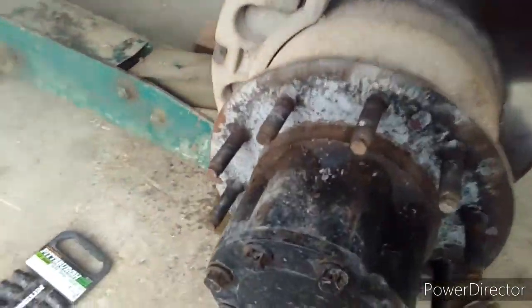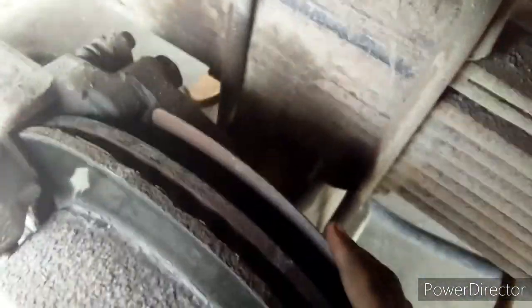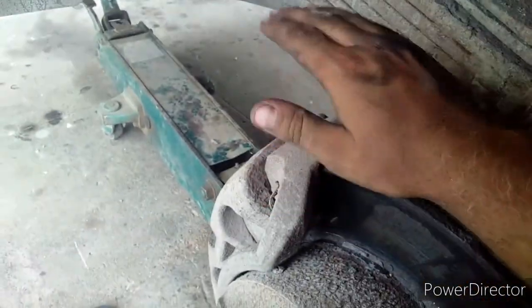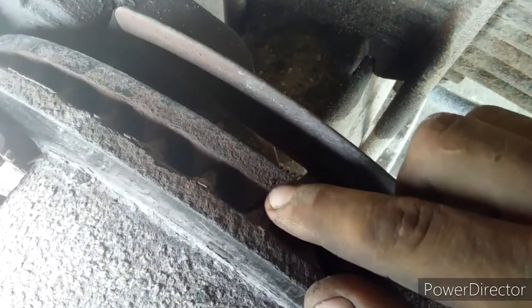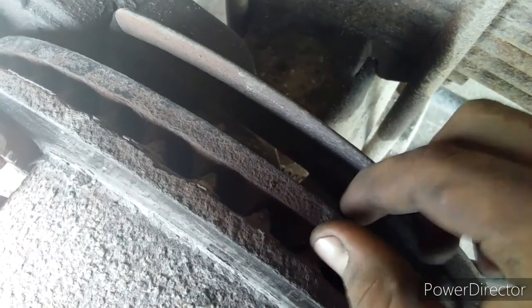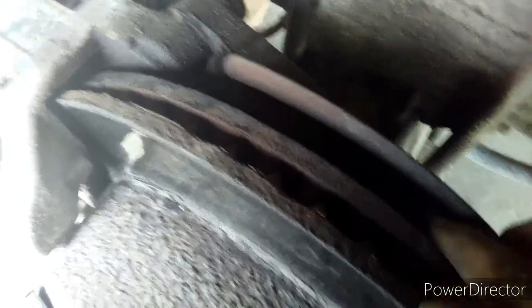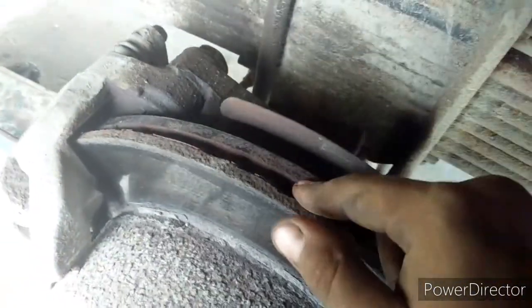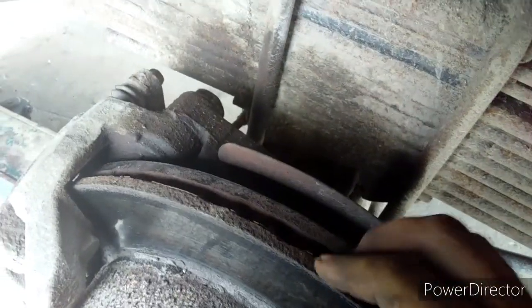All right, guys, so I thought I'd show you some of the issue. We're still trying to get it torn apart. It's kind of hard because it's been on for so long. These bolts here we're trying to get apart so we can take this whole caliper piece and fold it back, and then we can pull the rotor out. You guys can see that — yep, that isn't lined up. They're actually supposed to be lined up. They're actually broke. That's not supposed to be there, guys. That's the main issue.